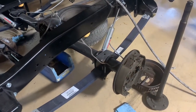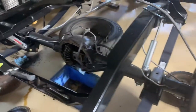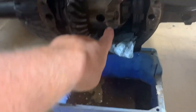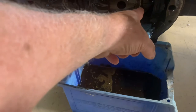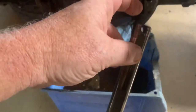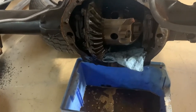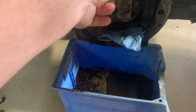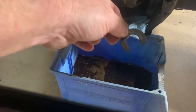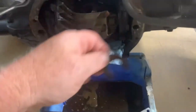My camera battery died, so let me bring you up to speed. We've got to remove the stock drum backing plates. To do that, you open your diff housing and drain your fluid. On the side you'll find a 5/16ths bolt — that's a long bolt holding a pin. When you slide this pin out, you can press your axles in and get your C-clips out. Your C-clips will be right inside where your spider gears are. Push the axle in just a little and the clip will fall out — make sure you catch it with a shop rag so it doesn't fall in the oil. There's one on each side.